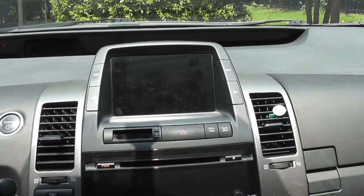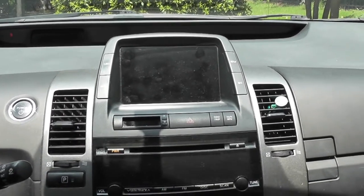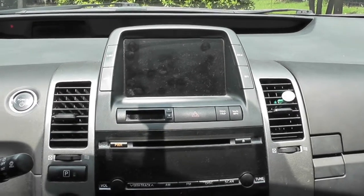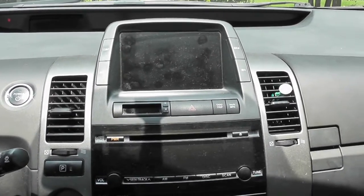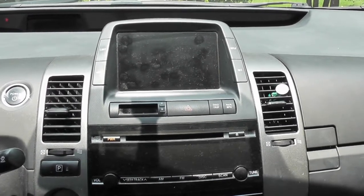I've reconnected the ground of the 12-volt auxiliary battery and installed the service plug, so we're ready to start the car. I've got my assistant in the back with the hatch open. When I energize the car, she's going to make sure there are no sparks or smoke before I take it for a quick spin.